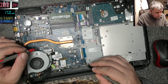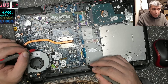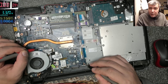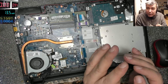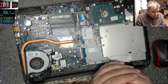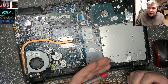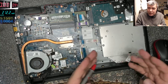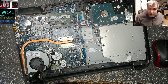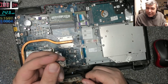On the power button ribbon cable we have 3.2V — probably the power button connection — and 3.3V confirmed on the multimeter. So everything is fine, the laptop should be working, but it's not. You think: what could I have done wrong? I just replaced a charging port — it's a basic job, a beginner job. No special knowledge needed.